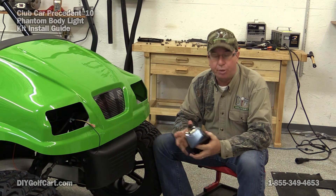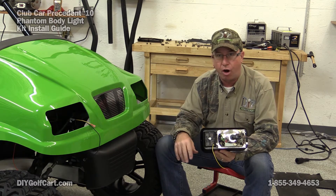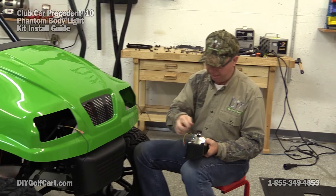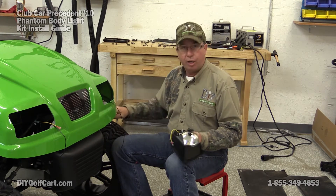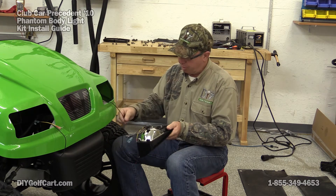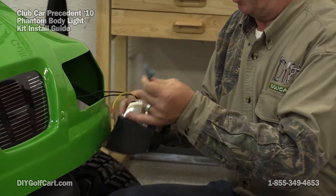Okay, now it's time to put our headlights on. If you look on the back side of each headlight, there's going to be a number of letters. The last letter will either be an L for the left-hand side, or an R for the right-hand side. We're going to start on the left-hand side. Now we have the black wire — we're just going to plug it in here — then the gray. We have an extra green wire that's going to plug into the yellow. And we have this extra black wire with a ring terminal. The yellow supplies power to the amber light. Right here at this nut, we're going to take the nut off, put the ring terminal on it to ground the light, and stick that back in there. This will be tie-strapped up when we go in to clean it up. Now we just plug our lights in.